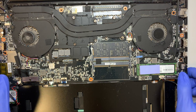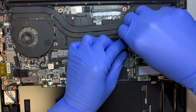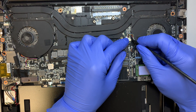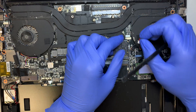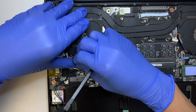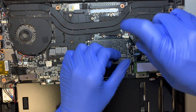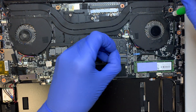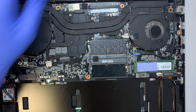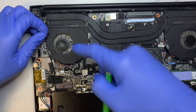The battery is removed. The next thing I'll do is disconnect the CPU fan power. This is the connector — again there's no clip holding onto it, it just slides in when you push it in. Do this for both fans. Let's go ahead and remove the screws — these are Phillips screws. There are two screws on this fan and maybe one screw on the left fan.